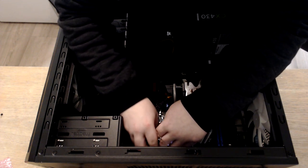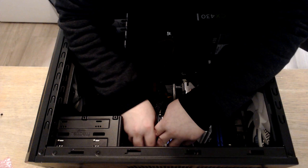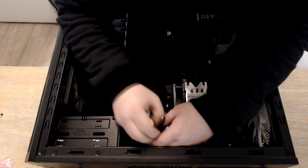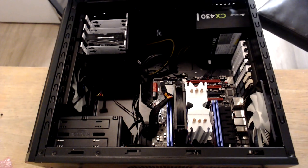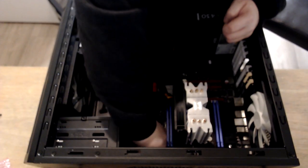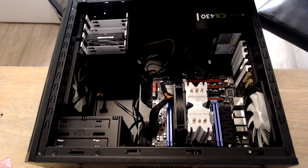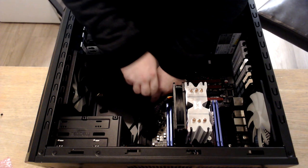I mean, SLI is pretty much dead these days, but you could actually get two GTX 1080 Tis and SLI them. And if a game actually supports SLI, you pair that against a 2080 Ti Super. I'd have to test that to make sure, but I'm pretty much convinced, FPS wise, because obviously the GTX 1080 doesn't have ray tracing. I mean, you can do it through software, but it doesn't have inbuilt ray tracing cores. But I'm 99.9% sure that it would come out above in FPS. And you've only spent £800 there, guys. So you've got £200 left over.